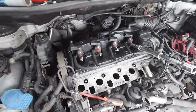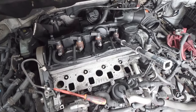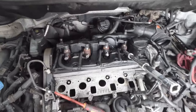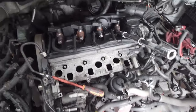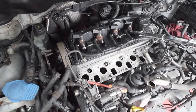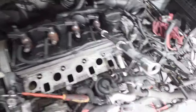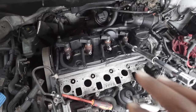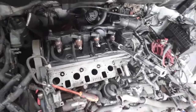This just means we have to push the head removal back to next week. I'm really determined to get the head off to see the state of this engine. A diesel engine is a lot stronger than a petrol engine, so if we just have a blown head gasket — which is the weakest part — and it's blown in a couple of areas, we know we can do a repair: replace all the gaskets and give the head a good clean. That would be better than fitting a replacement engine of unknown condition. I still have one lined up, but I want to explore the repair option first.